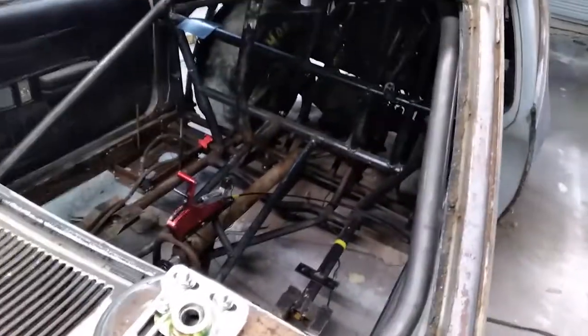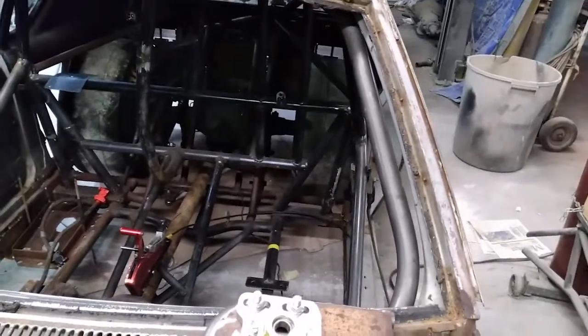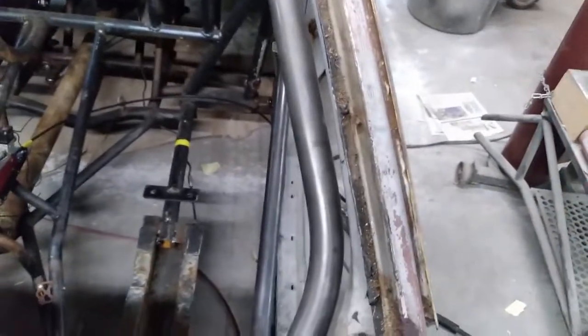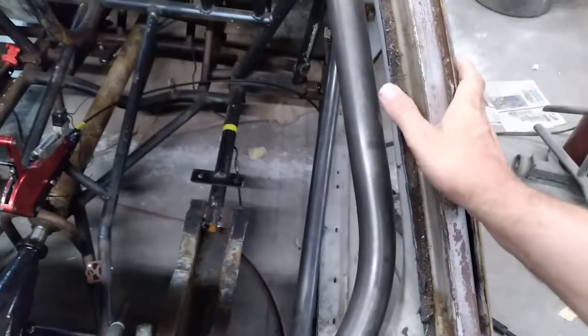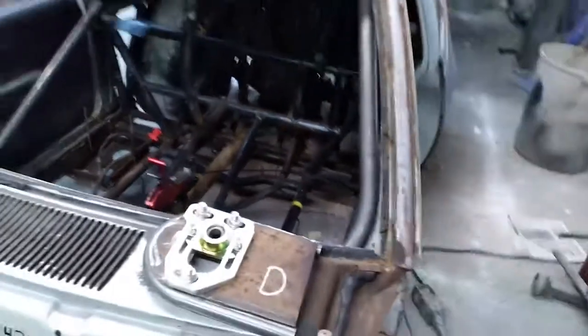One thing I want to show you guys — if you're building a car or going to put a roll cage in something, I see this a lot. It's very important, especially when you're sitting back in the car like this. See how you're sitting back pretty much at the B pillar? It's real important that you don't put your A pillar bar way out here. You can see it on Street Outlaws — the guys are leaned way over trying to see around that bar. If we were building a chassis car, I'd actually put this bar inside the A pillar, but this is just a throw-together, let's-have-some-fun car. So we just tucked it as tight as we could to the A pillar to make sure it doesn't get in our line of sight.